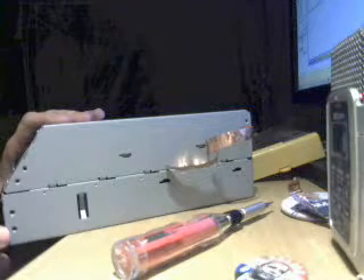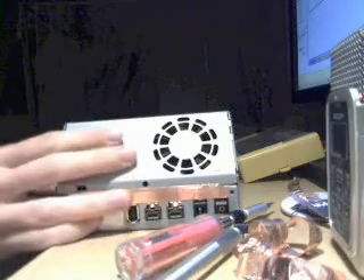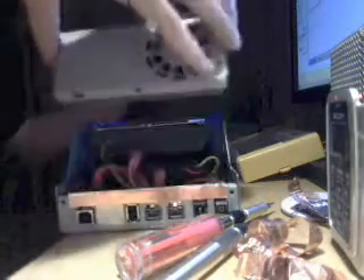Can you imagine that this is what you have to do just to replace a failed drive? I cannot believe this. You'll notice that this part here you just push in with one finger and it comes off — be very careful because it does have a fan connector on it. The drive inside this unit is actually mounted in a shock chassis and held in place by friction. We remove the serial ATA interface, which releases everything on the drive, and then the whole thing you simply apply a little bit of leverage.